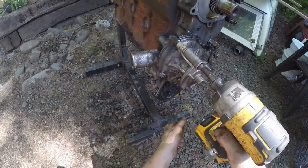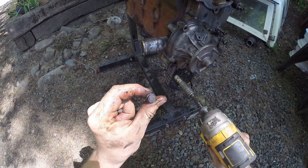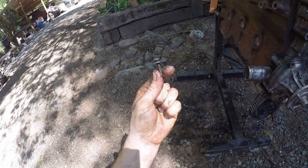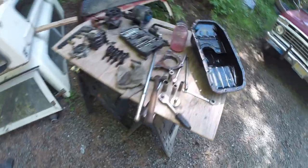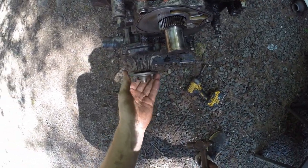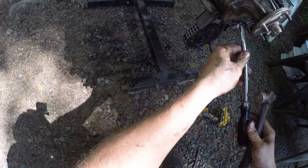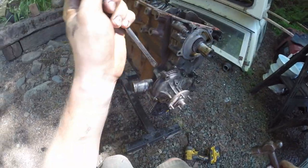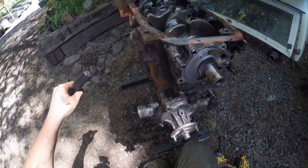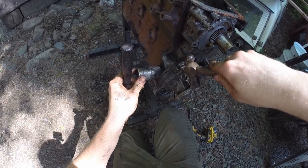Go easy on these 10-mil bolts. That's an aftermarket bolt — actually, it's not aftermarket, it's been shaved down unevenly. It looks like maybe a stock bolt — bizarre. The water pump has been pretty well glued on there, but I still want to know. I can't even really complain that it's glued on there with what looks like Toyota-flavored RTV — or maybe high-heat RTV, which would be the wrong application. I saw it on the header too, so it's one of the two.